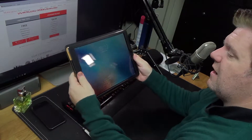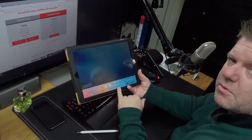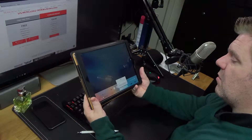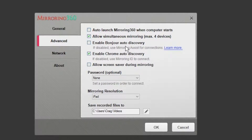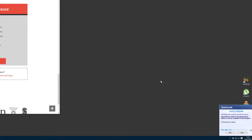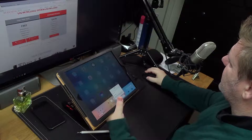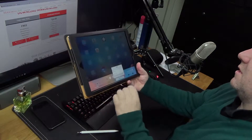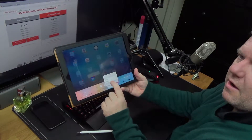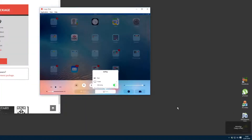Once that's running, over to my iPad: you need to switch on your Bluetooth and wireless because this connects through WiFi. AirPlay should pop up as a button, but I'd actually deselected an important setting — you have to enable Bonjour for auto-discovery. Once I did that, my computer named 'Flood' came up in the AirPlay option, and clicking it mirrored my iPad screen straight to the laptop.